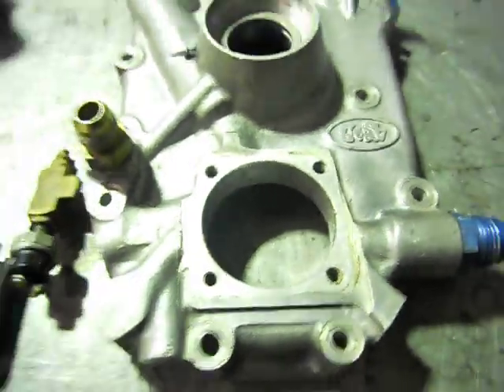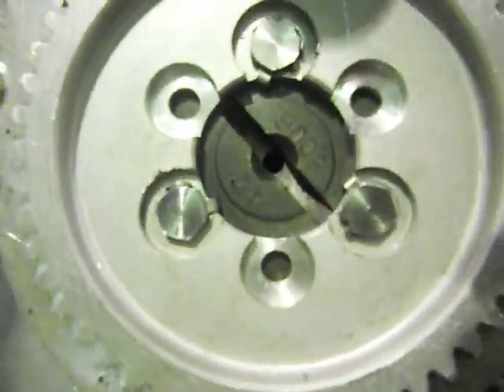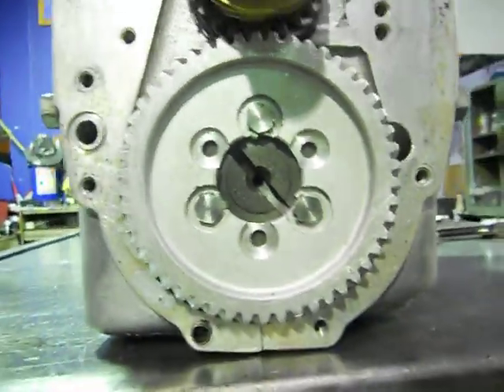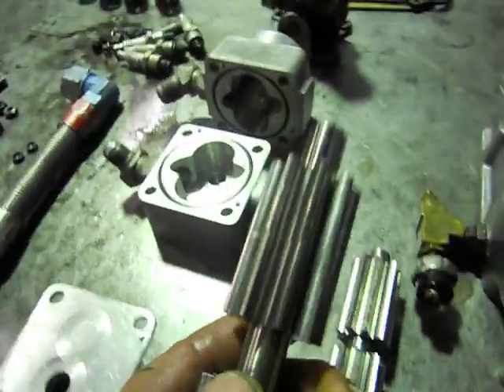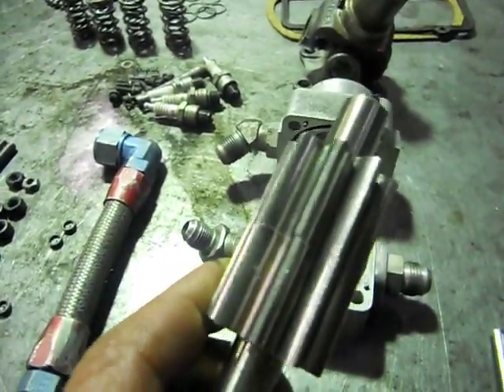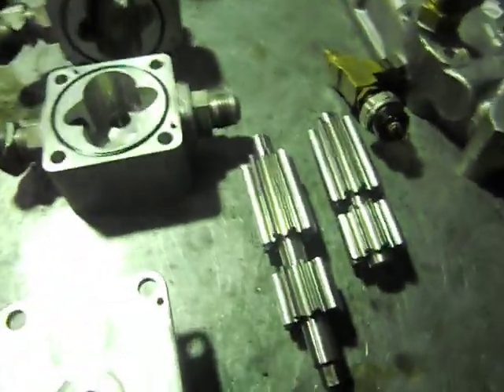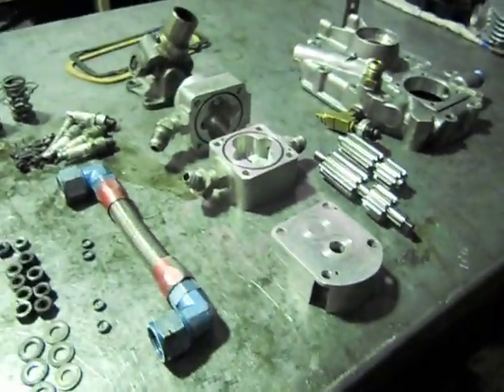When we pulled the pump off the front cover, you can see where the oil pump bolts to the front cover and the actual oil pump drives off that slot — it's a tiny little tang that fits in there. When we pulled the pump off, all the broken pieces were just sitting there. We pulled down the pump and found that the pump is severely worn all inside — it's an aluminium housing with steel gears and there are severe scuff marks on the end. What happened, I'd say, is because of all that excessive clearance and movement, the drive shaft for the pump actually seized momentarily and with the cam still wanting to turn, it broke that tang.